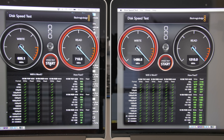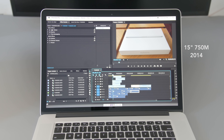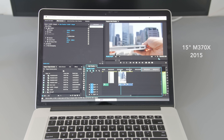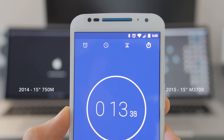Let's take a look at the drive speeds. The mid-2014 model is on the left coming in around 600–700 MB/s read and write, which is pretty fast. The mid-2015 version is on the right with read and write speeds around 1,500 MB/s — really fast. But with multiple layers of video to scrub through, even the 2015 version drops frames because the processing just can't keep up. So there are very few applications that can really take advantage of drive speeds this fast on a notebook. Boot times are also pretty similar — the 2015 version is slightly faster.